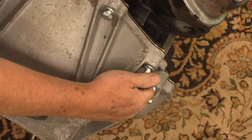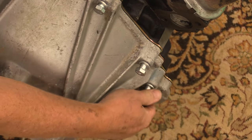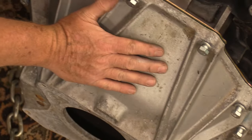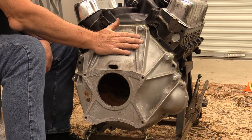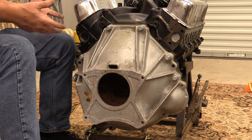I'm going to get some of these bolts started to hold the bell housing in place. One last thing to mention on this is starters — if you're doing this with a manual shift bell housing, the manual shift starter is different than the automatic starter. If you plan on doing a lot of small block 302s or 351 Windsors on the Ford side, you'll want to find yourself a manual shift bell housing and a manual shift starter.